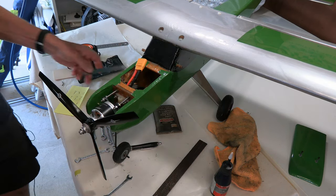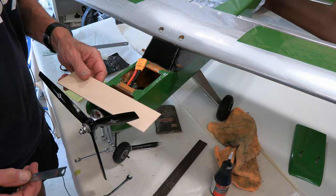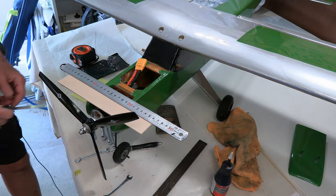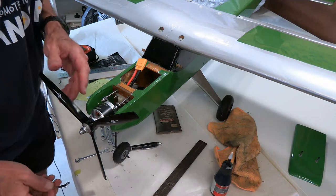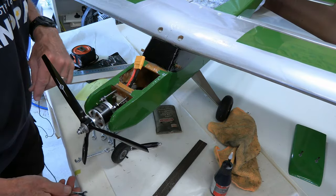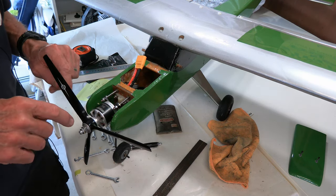Let's just see where we're at in terms of our original measurement — that's about five mils. It was six mils, so it's a tiny bit higher than what it was. We could go down a milli-smidge. That's nice and tight. For security's sake, I've put a drop of thread locker just under the threads on the outside of these. We've got nylock nuts on there, and they should be held in place with the nylon locking mechanism.